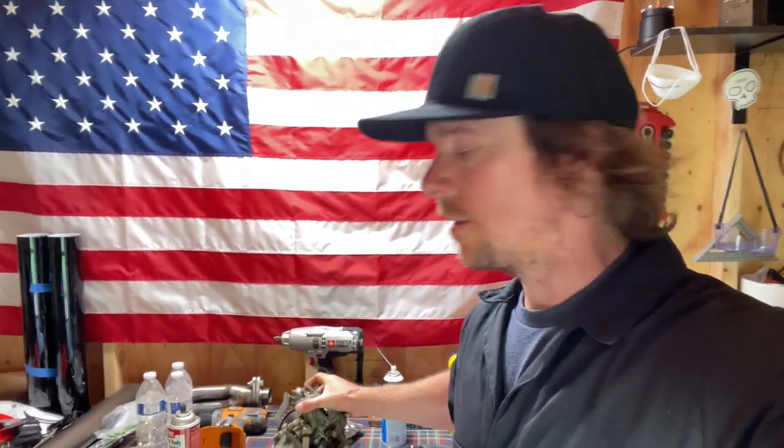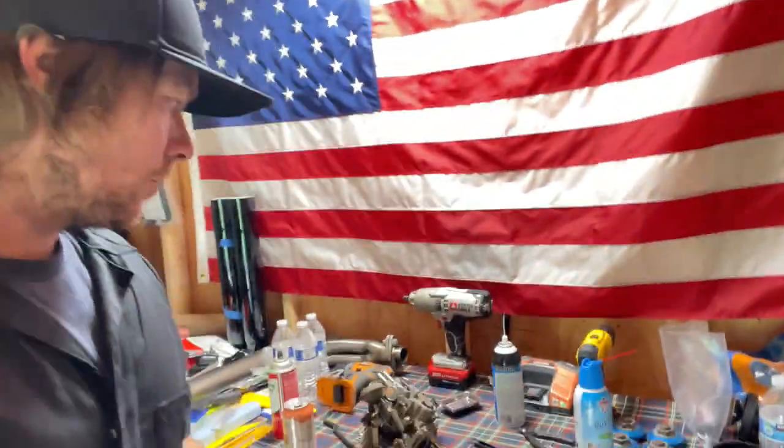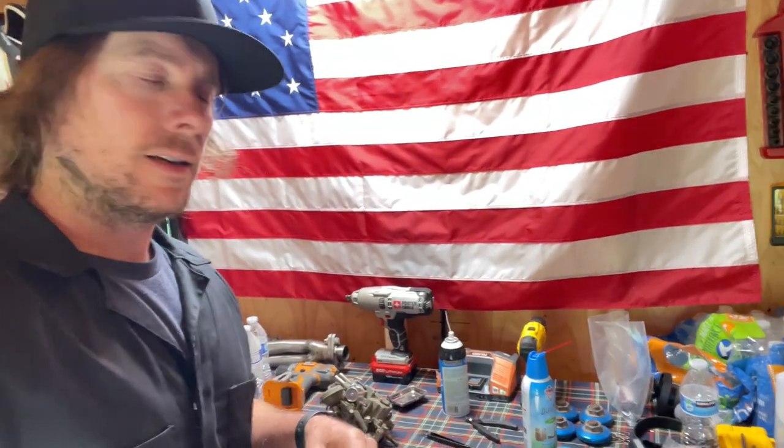But I thought, hey, put some more options out there, try to start rebuilding these, because they're getting older and older as time goes on. Parts are no longer available. I tried to buy a bunch of parts to rebuild a carburetor, and it was available at the time, but after I checked, they all came back no longer in production, which is a huge bummer. So basically nothing except for the solenoids, accelerator pump, and gasket kit is available.